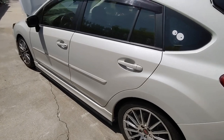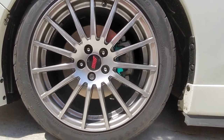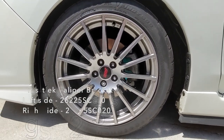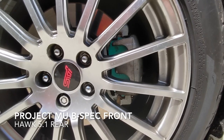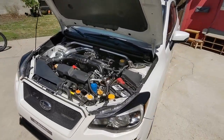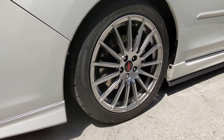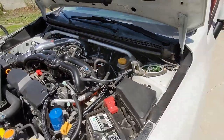Tail lights are stock, I just put a little bit of yellow tinting over them — I'm in California by the way. The pads and rotors are upgraded to a Crosstrek-size rotor, which uses a larger brake caliper bracket to accommodate the larger diameter, so it's a good easy brake upgrade. For pads I'm using Project Mu New B-Spec — it's a high performance, high heat pad, very similar to OEM sound and braking capabilities. I'm still using rubber lines but I've upgraded my fluid to DOT 4.